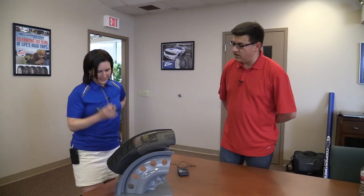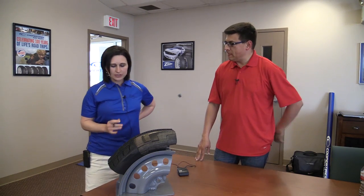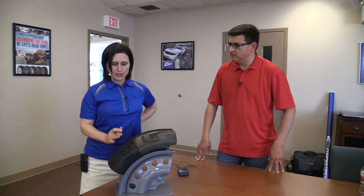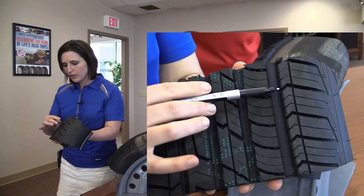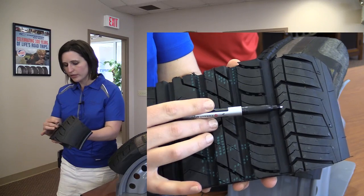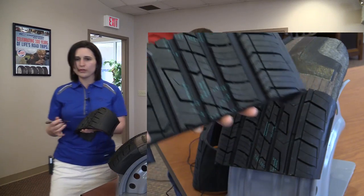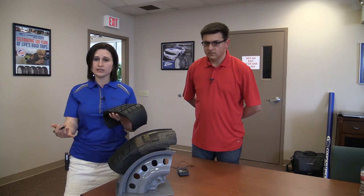One of our viewers was asking: what makes a tire noisier as it tends to age, especially directional tires that tend to be on more sports-oriented vehicles? Directional tires tend to wear in what we often call a heel-toe type of situation. If you look at an individual tread lug, when it wears it tends to wear at an angle — this side will stay up high where this side will be much lower and flatter. You get sort of this diagonal wear that, as it runs down the road, causes rubbing of the tread lugs. With as many tread lugs as the tire has, that tends to create more noise in your vehicle's cabin.